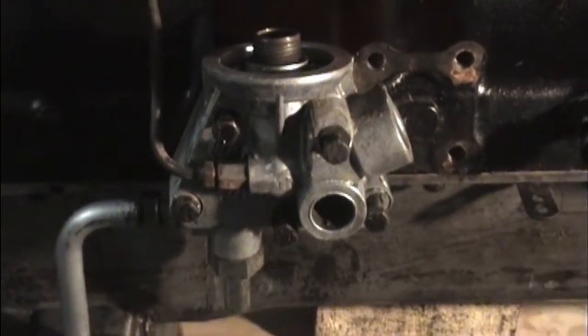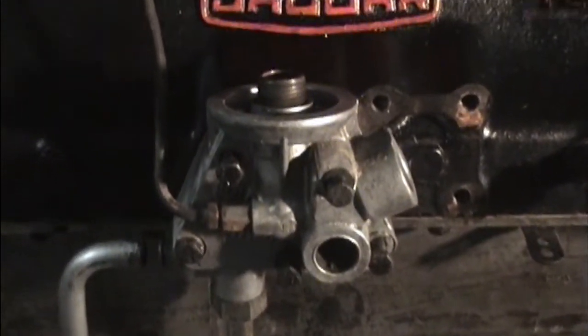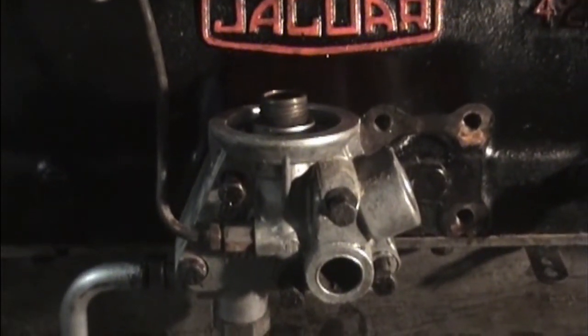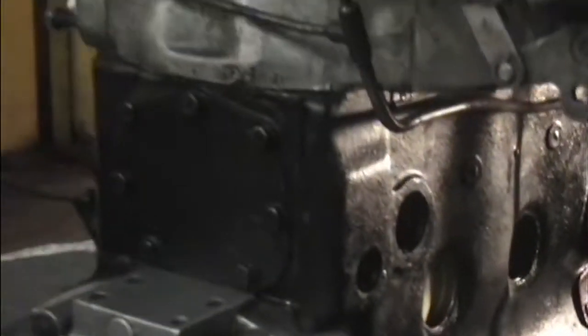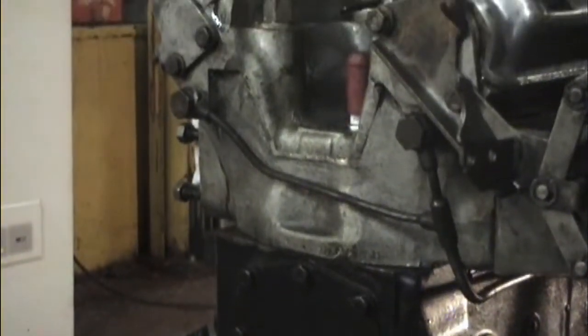This is the oil filter housing with a vertical oil filter, rated at 40 odd litres a minute. Also using the filtered oil takeoff for the camshaft feeds, feeding up onto the back of the head as normal.